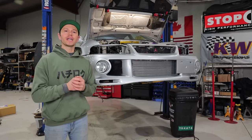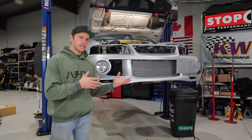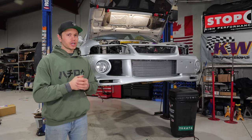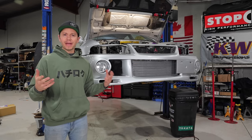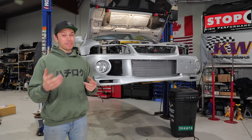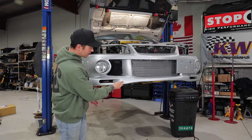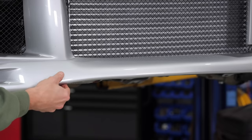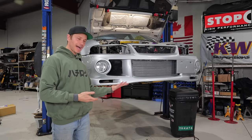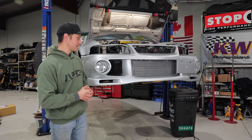The lips had overnight to cure, and the sealer, the urethane, didn't actually harden. I did a little bit of research and I couldn't find a urethane-based sealer that does harden, so I'm not sure what's on the other side. But the flip side is, it actually works in my favor, so it does have a little bit of give, but it's holding this lip on quite well. So, you know, if you bottom out or whatever, it's going to have a little bit of play. So I think that is almost a benefit for me in that sense.